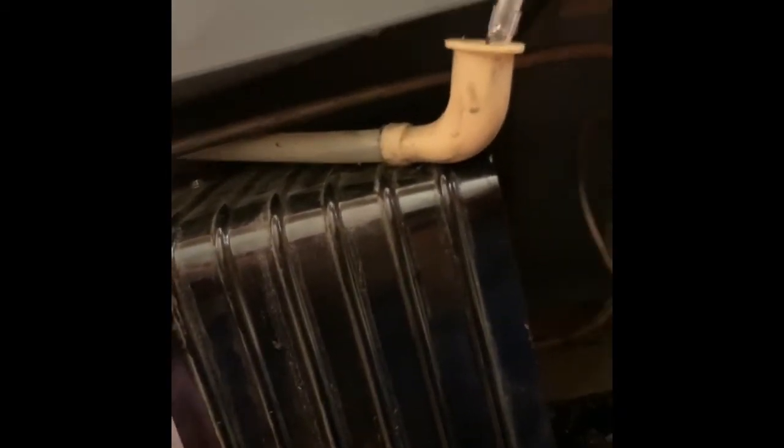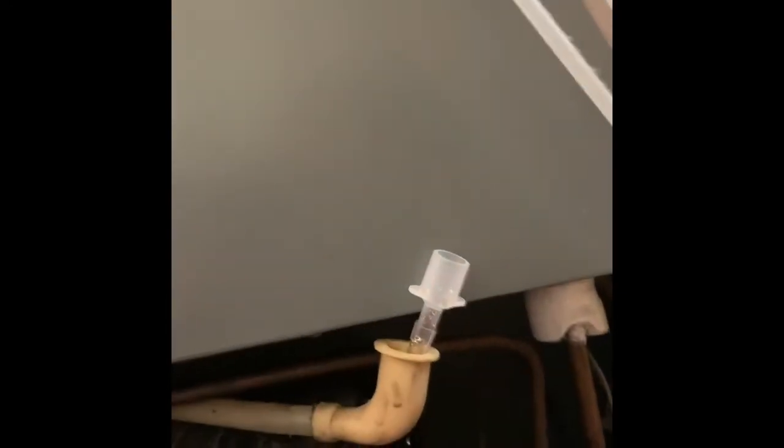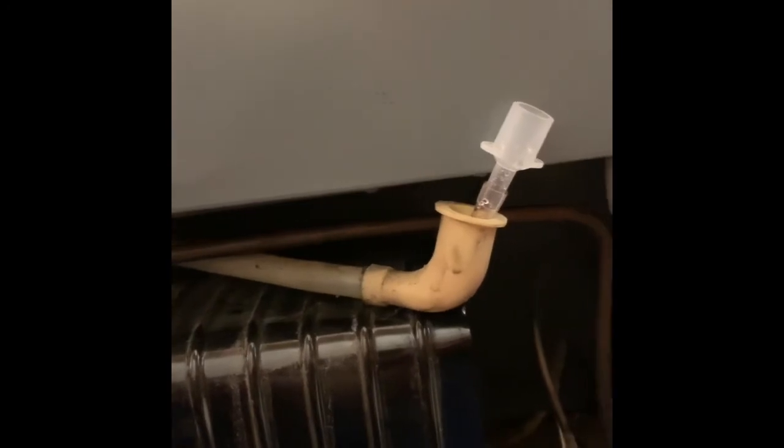I'm sure there are a lot of different ways you could do it — you could probably get a coat hanger and carefully feed it through, or a turkey baster or something like that, just to flush out the system. This is in case the normal approach of going from inside the back of the freezer doesn't work for you — there may be a bigger clog further down. That's just my first attempt at MacGyvering this fix. Thanks for watching.